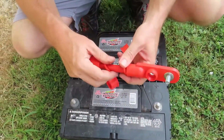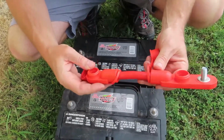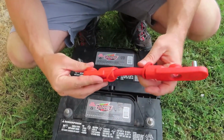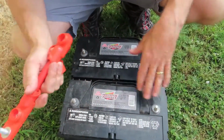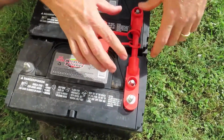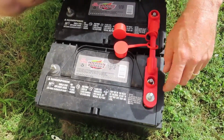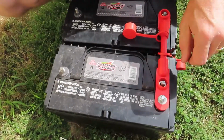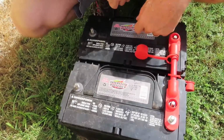So what I like to use for these, and what I use in our rig, which really works out, are made by Quick Cable. I will leave a link in the description for these so you guys can see what they are and get a price on them. But this is a 2-aught jumper that Quick Cable makes strictly for group 31 size batteries. You can see they're pre-cut, so they fit right over the studs, perfect. And then it gives you an extra stud on the end to actually hook your main connection to. It has caps, so that once you bolt these down, you can cover it, keep them safe. So super good setup. I've been very, very happy with these jumpers in our rig.